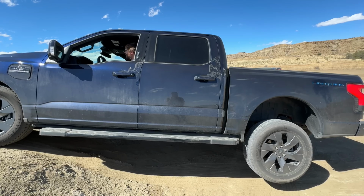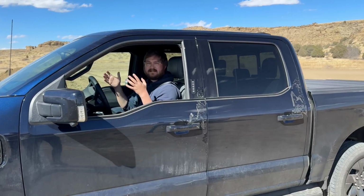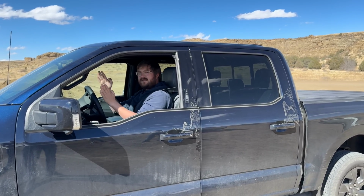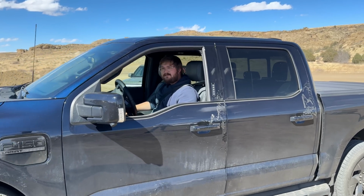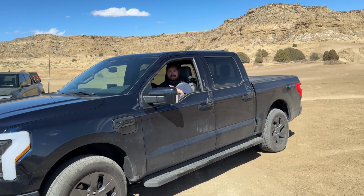So it's wonderful to have a locking differential for certain situations where you are in a split mu surface. And split mu surface means that you have a different level of grip on the left and the right side of the vehicle, or really in any combination. So split mu is when locking differentials become really beneficial. I think everyone kind of understands this concept.